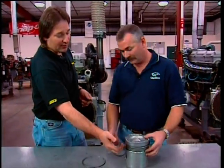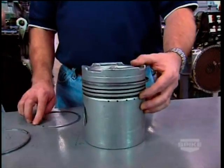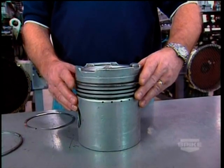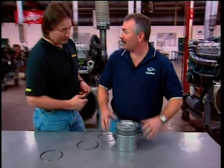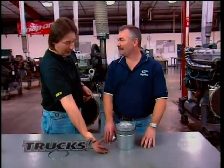There are three compression rings and they're all the same keystone design. So if something happens and we get a little relaxation or lose a little past one ring, the others are going to continue to make that same type of compression against the cylinder wall. Of course the lower ring is the oil ring.